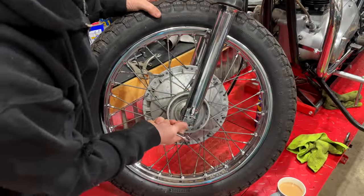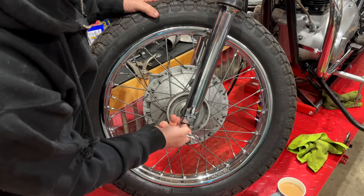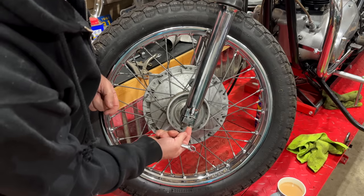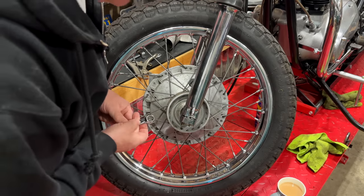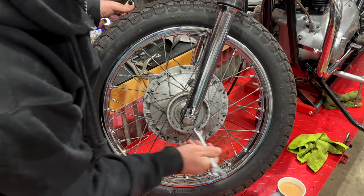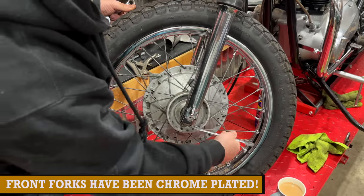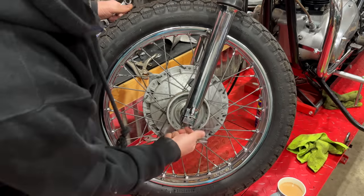This wheel is just loosely fitted. I took it off when it was down at Jeff's. And what we did notice is this stud here, it's got the wrong nut on. Instead of being a half inch standard, someone's put a Whitworth nut on it, and it's locked onto the stud like a lock nut, and so the stud comes out as well. Fortunately, the thread's still good, but it comes out like a bolt.